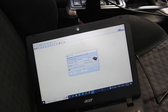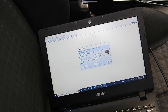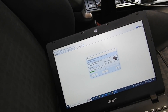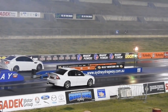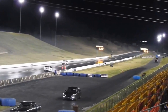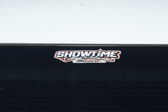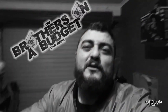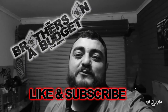There you go — if you've got a tuner-locked PCM, you can just short that pin to ground, then upload a stock tune and get your PCM back, so you won't be buying another one.